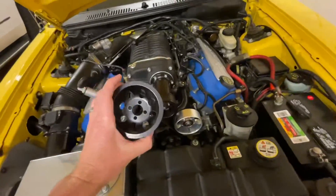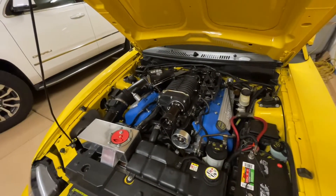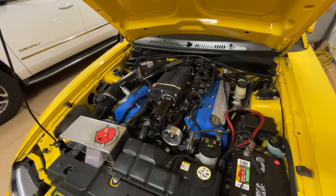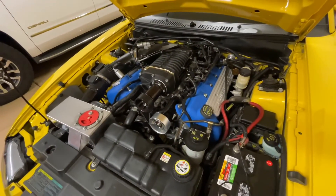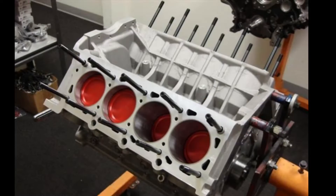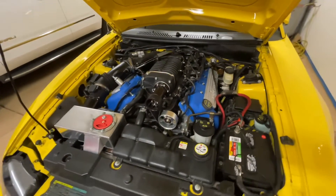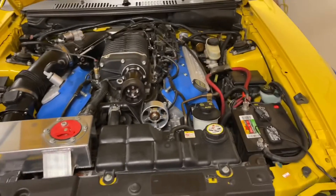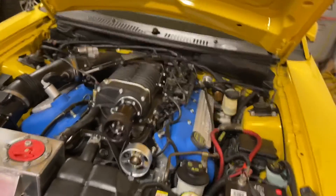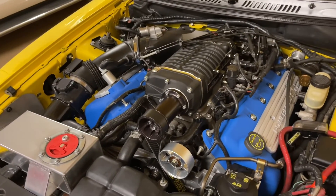Let's talk about the fuel limits. You're going to have to pulley up on the top with a bigger upper, or go to a smaller lower, just so your tuner can tune the car for the street — unless you're on strict race gas, E85, or something like that. Even with that PSI level being too much for the fuel, if you overcome that, now you're going to have too much PSI for the heads. You're going to have to go to head studs. Even for some of the bigger TVS like the Gen 3R 265, they talk about needing a built engine. The Terminator engine comes built with forged internals, but there are other things you'll have to do — like head studs — just to keep the engine together at that PSI level, assuming you have the fuel to keep away from pre-ignition.